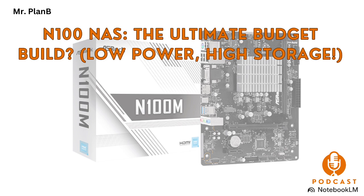So we've talked about the pros and cons of N100s — how do they stack up against other options for building a NAS? Let's compare them to traditional dedicated NAS-focused motherboards from brands like ASRockRack and Supermicro. These boards usually offer more features geared towards server use, like additional SATA ports, ECC memory support, and more comprehensive documentation, but they usually come at a higher price. It's like choosing between your basic toolkit and a professional-grade workshop — you get more specialized tools with a professional setup, but it's going to cost you.